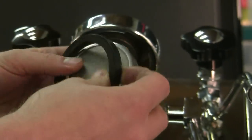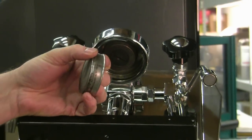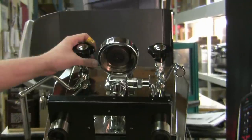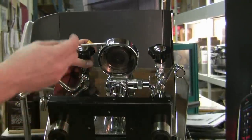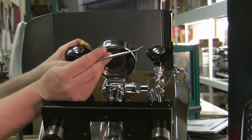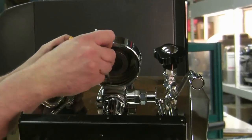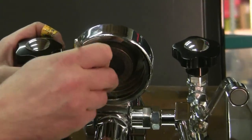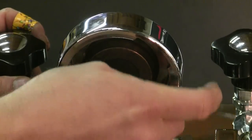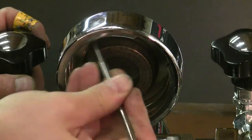So you take out the gasket and screen and separate them. Next, you're going to clean the group head. If it's really dirty, first thing you should do before using any cleaning detergent or water is get in there with a dental pick — something like this — and get underneath the group head ring, because that's where coffee is going to stick the most. Go around and clean that out as much as you can.